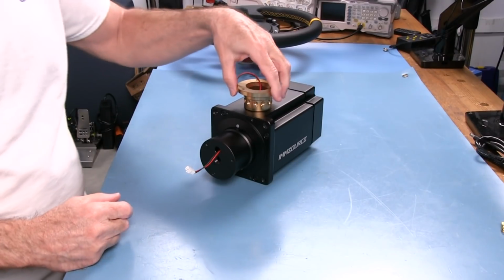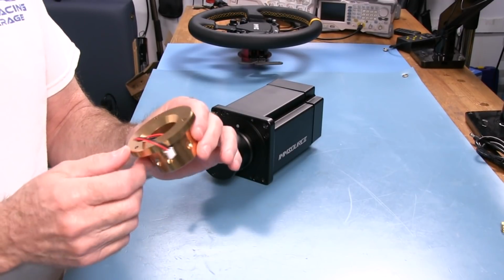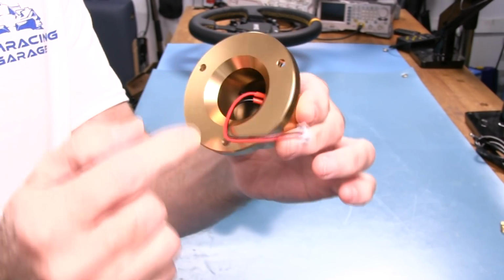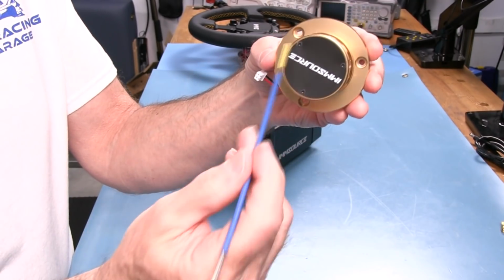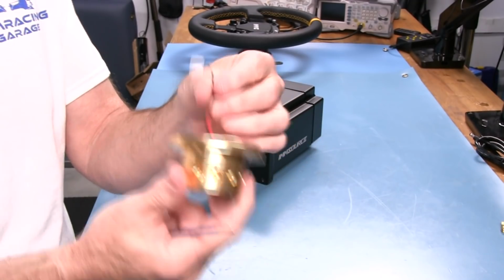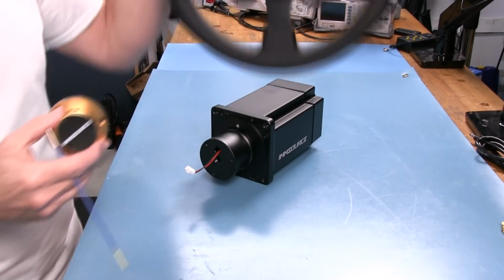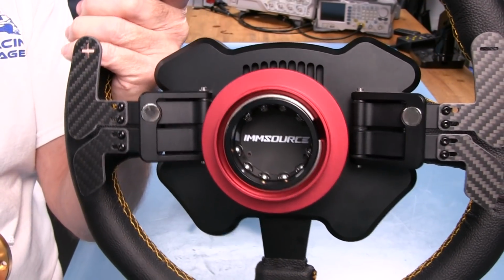First, I took the front hub adapter off, and I wanted to show you guys the coil that's in here, the transmission coil. And you can see inside of there, see those bare wires. And of course, each one of those wires is attached to one end of the coil. And of course, that is circling like this inside. And once we put power through this, then we induce a current flow over there on the other side on our wheel that you saw before in a closer look on the wheel. So that's the receiver coil in there.